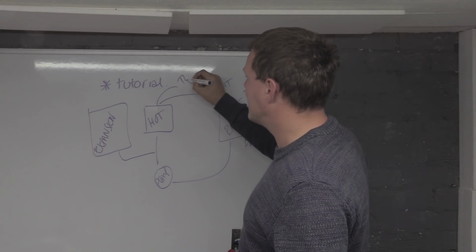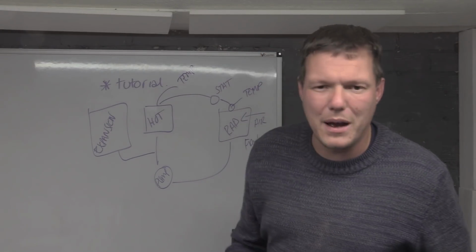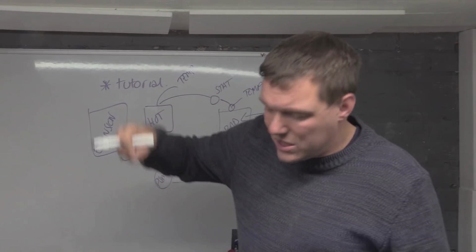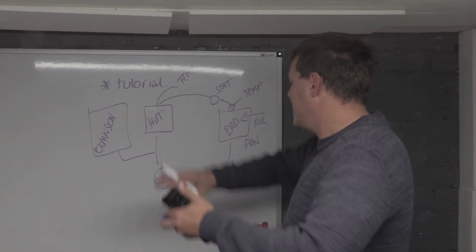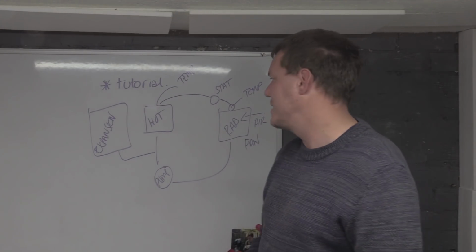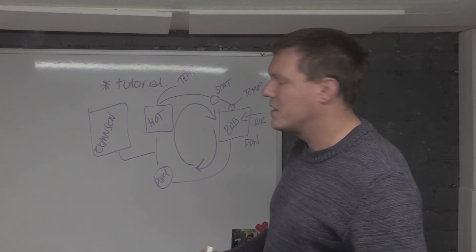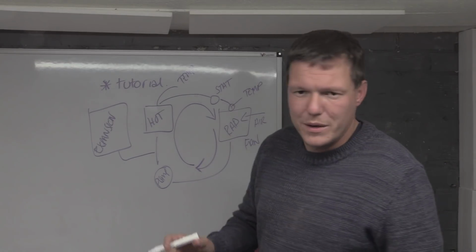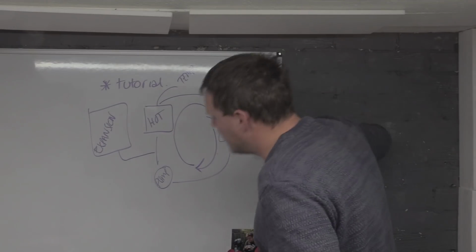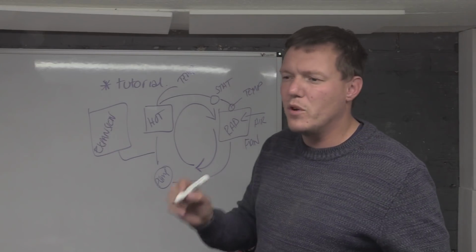In some things you have temp sensors, like two strokes, you can actually put them on thermocouples and stuff, on the spark plug. Some two strokes have temp sensors in the cap, you know what I mean? There's loads of variations on this system, but the system is very simple at the end of the day. It's a heat exchanger. You are circulating a liquid, a working fluid, from the engine to somewhere to be cooled, and then as it cools, you're pushing it back into the system.